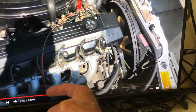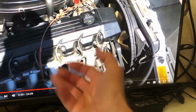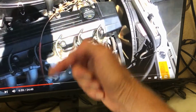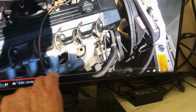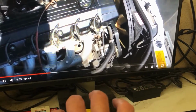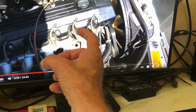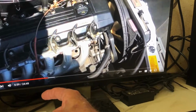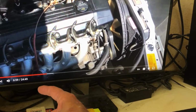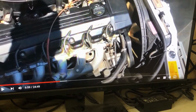And it had got so hot, the coolant got so hot that it went up the expansion tank and into an overflow reservoir, which is located behind the front wheel on the passenger side, behind the inner fender cover. You take that off and there's a whole other tank there. When that happens, it overflows into that overflow tank, and as it cools down, the coolant gets sucked back into the expansion tank. So anyway, that whole system is working good.